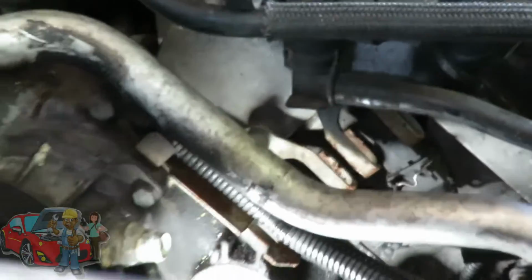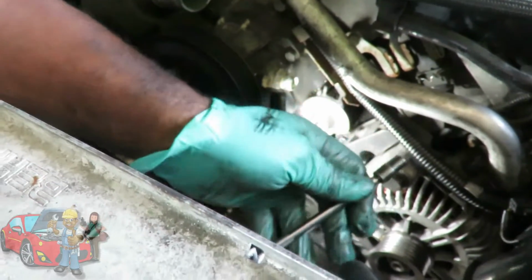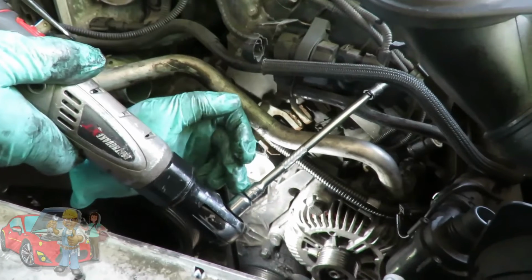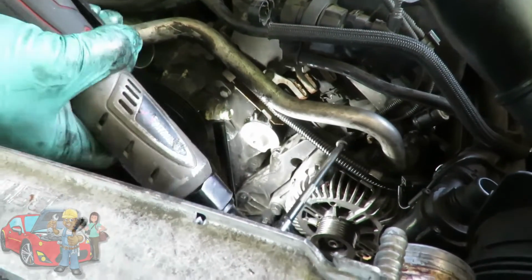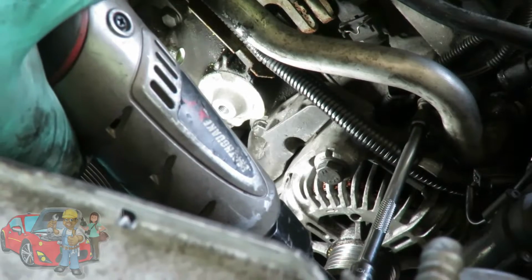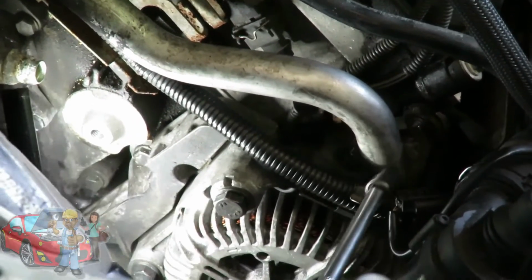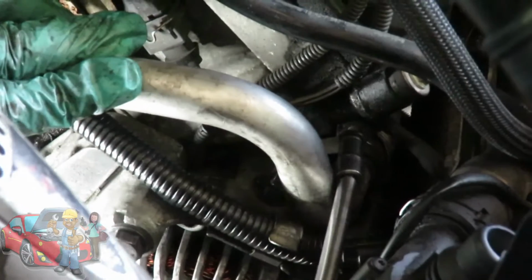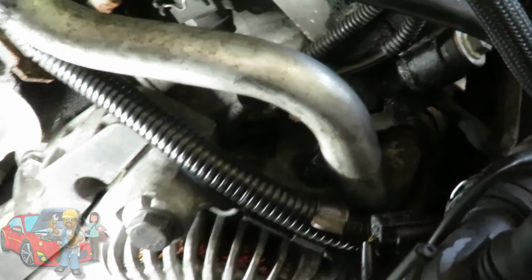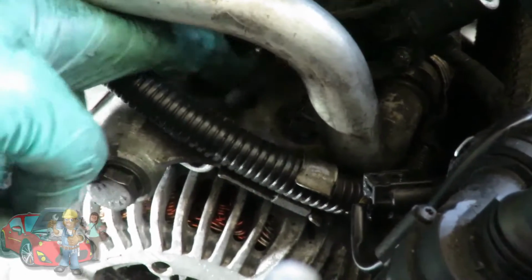Alright, what I'm going to use is my 6-inch quarter-inch drive extension with my E8 inverted Torx socket, and I'm going to use my big bill. Also, I'm using a reducer, 3/8 down to 1/4 inch. And let's go in there. Okay, let's get the top one. The bracket's very important. It keeps our wiring harness out of the way, and especially this wire right here. All right, we got that done. We'll be right back.